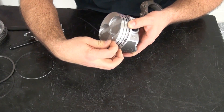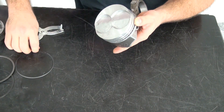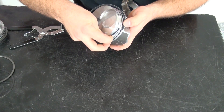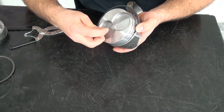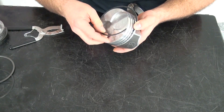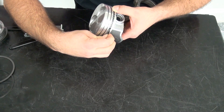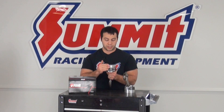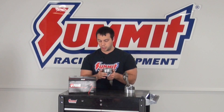When I get to the end, I'm going to pull the end of the ring away from the piston so that I don't scratch the edge. For the last oil ring, I use my thumb and push it in above the expander ring this time, sliding it around and pulling away ever so slightly from the edge of the piston. You want to make sure you pull it away so you don't scratch it, causing a loss of compression or damaging the piston. But don't pull too hard because you don't want to damage your rings.